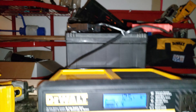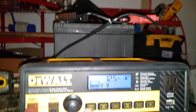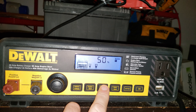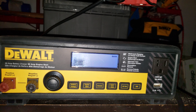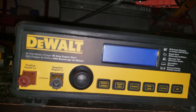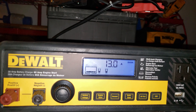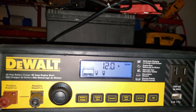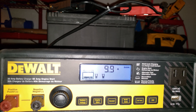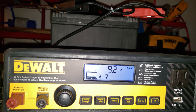I just got it in the sunroom here — unheated, unvented. I'm not going to let it charge in here long; I'll move it out to the shed. Battery voltage is 12.5 — it's on bank one. Let's go to recondition. That is charge, I guess. Going to a boost setting — showing 13, 12, 8 amps going into it. It's nice to see it does go to multiple different settings.